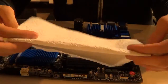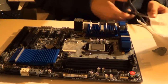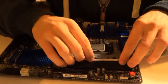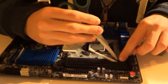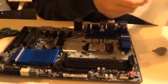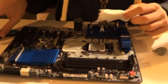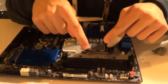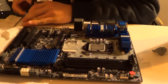Then we take a piece of paper towel — you'll probably have to cut a little custom piece, little slithers like this. You can use other methods, anything is fine. Just make sure that you close that up, because I guarantee it will get cold and frosty over there. Use your brain and know that this air will get very cold — your memory has coolers on them, and the coolers get cold from the CPU part and then they make their own set of problems, so just insulate it well and don't forget about the memory.